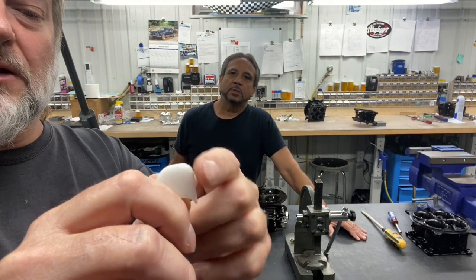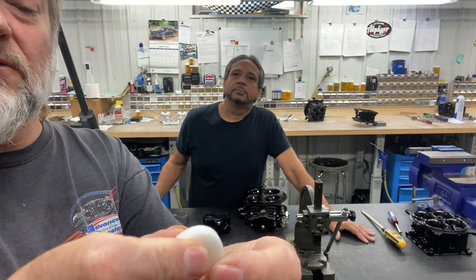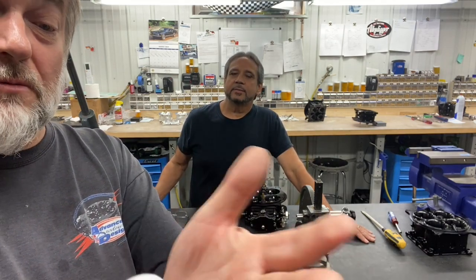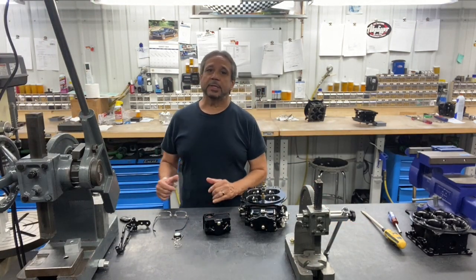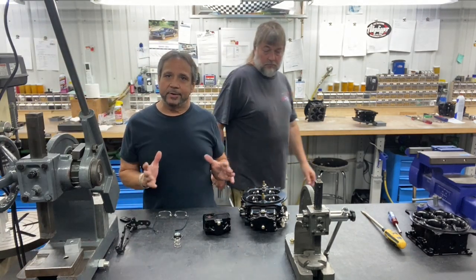Foot brake is very critical — the car leaves clean for reaction time. You can see this side of the cam is very aggressive, which is how we normally run them, but there are applications where we flip it over and then this side gives you the same lift but at a much slower rate. For a foot brake application that would be important.